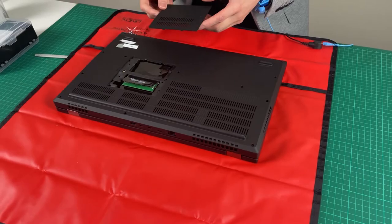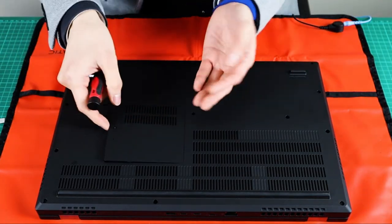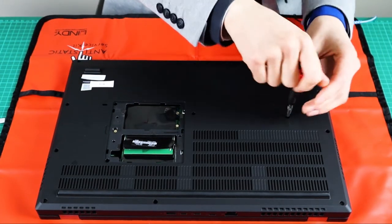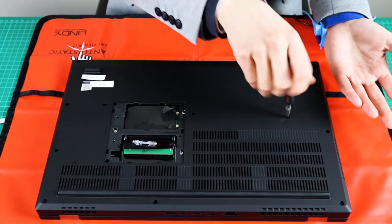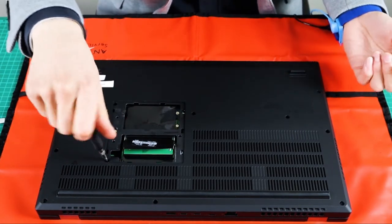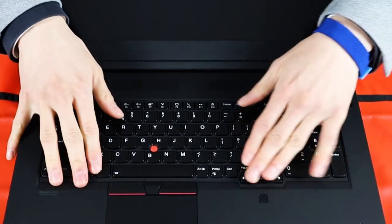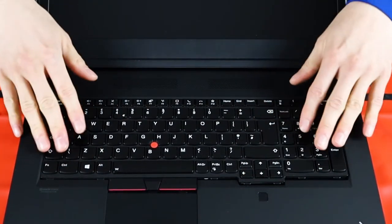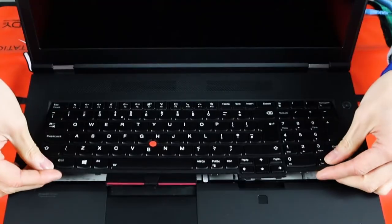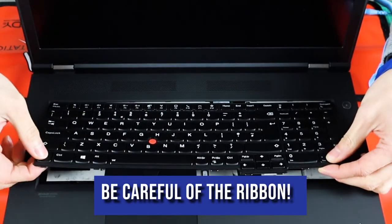What we'll do now is take a look under the keyboard. To disassemble, you undo a small cover and two screws to access the keyboard. Check the hardware service menu rather than just following YouTube. I think it's just a matter of sliding the keyboard — slide it this way, then lift it up. Move it gently and be aware of the ribbon cable underneath.